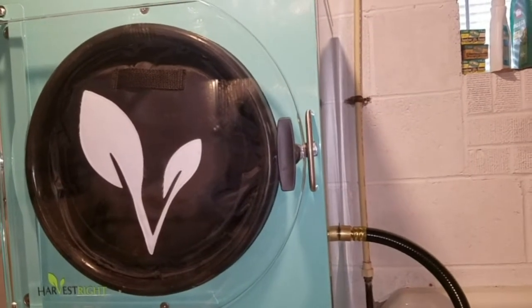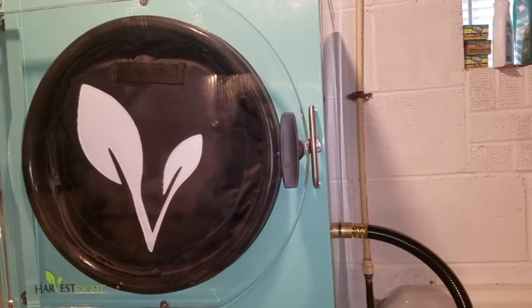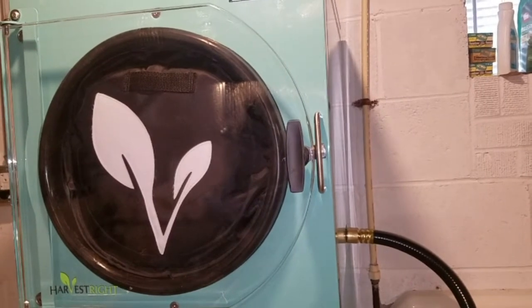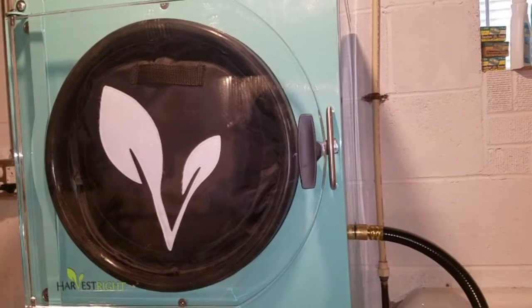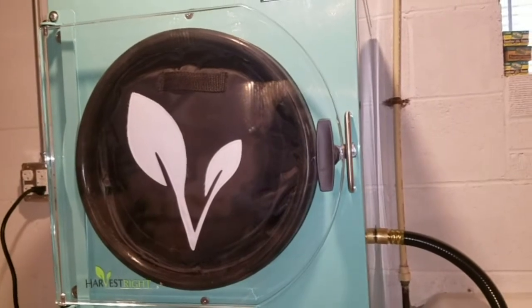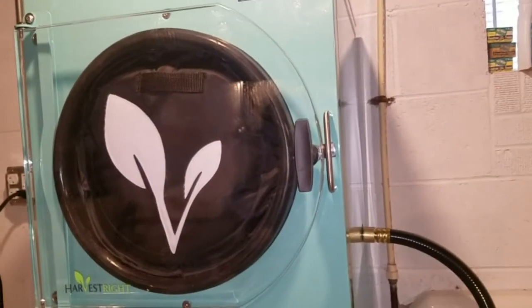That dropped down to I think it was 160 mTorr, millitorr, I think. But anyway, that's it. We're starting freeze drying now. Like I said, this is a sacrificial run. This will pull out any smells from the heating elements and such, for sublimation.